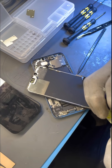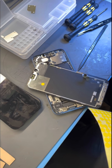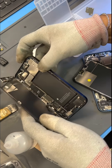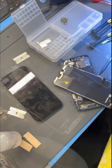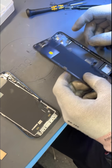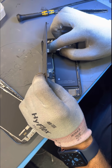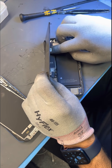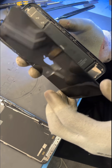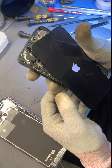Now it was time to tag the screens and iPhones so we could show on camera that we were swapping them. Ultimately we're going to swap over one of the screen ICs — the microchip that sits on the screen. The black iPhone 13 is tagged with a white tag and the blue with a yellow. Here we are swapping the screens over: attaching the screen marked with a yellow tag onto the iPhone tagged with the white tag, to test for a display message and how Face ID reacts. If you've watched other breakdown videos you'll understand this is going to show an error.